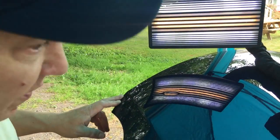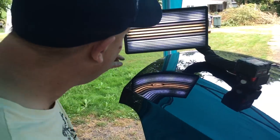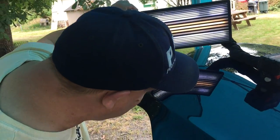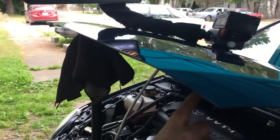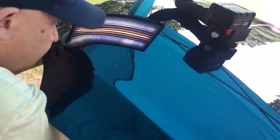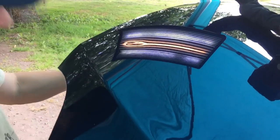Hello world, PDR coming at you here with a 2012 Scion dent on the hood. I know my light board is still a little bit flashy, but you guys got a good angle on that dent. These are all factory holes — there's a factory hole up underneath this thing. I've just got my tool up underneath there, and let me get that angle that I need, find my spot, and I'm gonna start right near me.